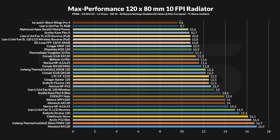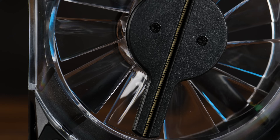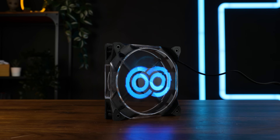I also installed them onto our radiator fan testing machine, where I made them spin at max to see how low above ambient they can keep the water. Surprisingly, these are way better as radiator fans than case fans. They are still very far from good, but at 13.9 degrees C above ambient for the water it is not ridiculously bad anymore. Though the noise-to-performance graph for rads is pretty much the same as for cases — that's just catastrophic. Was this a surprise? Definitely not. How Coolify glued a fan-obstructing holographic monitor onto an already outdated fan design — of course this isn't going to perform acceptably. For me this is a concept, but it's a really freaking cool concept.